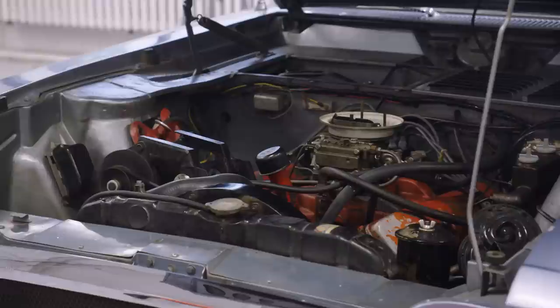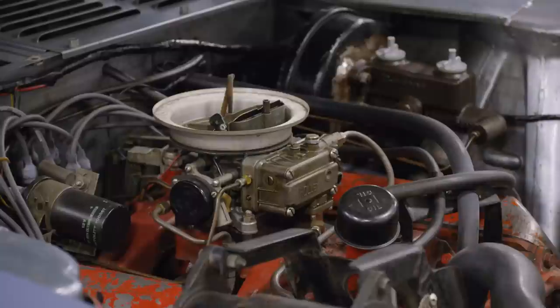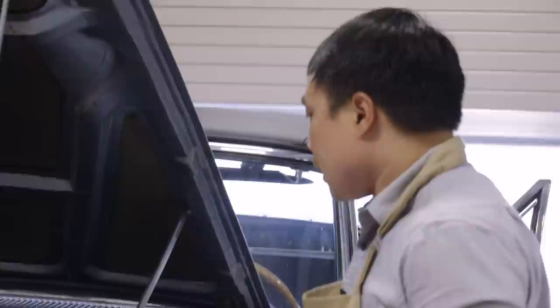Some of the gauges aren't working as well as I hoped — like the fuel gauge. It may be low, I may not have put enough in, but it's still running so it's getting fuel. Oil pressure is building up pretty well, which is a good sign — that's pretty stable. Stuff like the hoses have likely been replaced; rubber doesn't do well with age, same with all the ignition wires. I'm also seeing some white smoke. In storage, one of the things we do is put oil inside the pistons so they don't seize up — it might just be burning off right now.